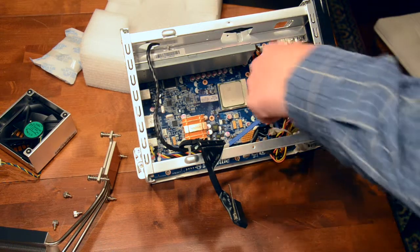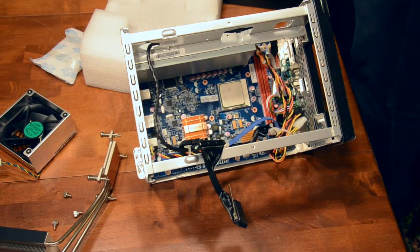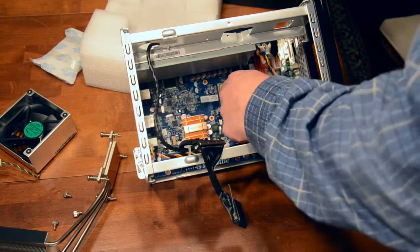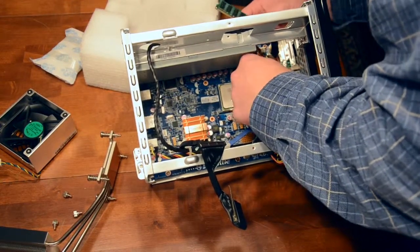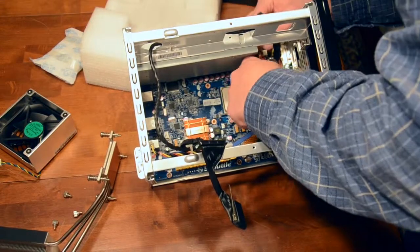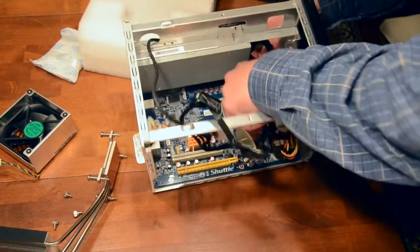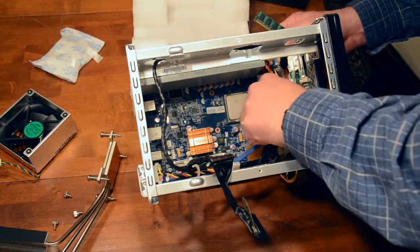And next thing we want to do is put the RAM in before we cover that all up. So again, going back to the old motherboard, which is dead, I've got a couple of sticks of DDR2-800 RAM, 2 gigs each, so it'll give us 4 gigs total. So there's a little, I guess I could move some of these wires, but it's not too bad. Can sort of move around them. It's not as easy as working on a bare motherboard, but it's not that bad. And the advantage is the size is considerably less, a considerably smaller system than what you would have with a typical PC.